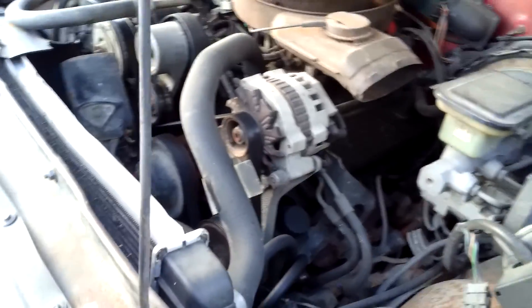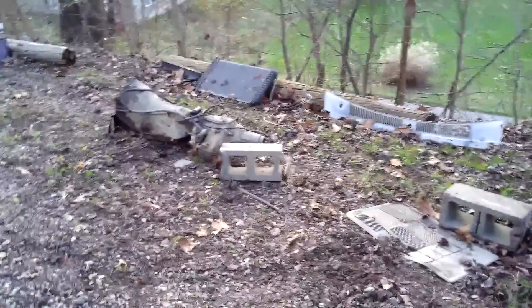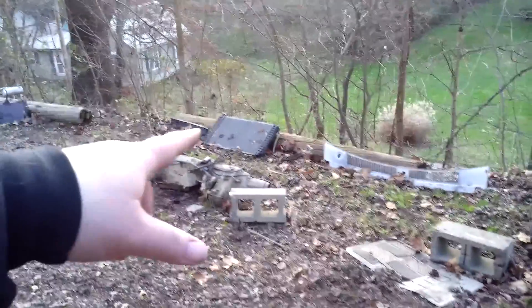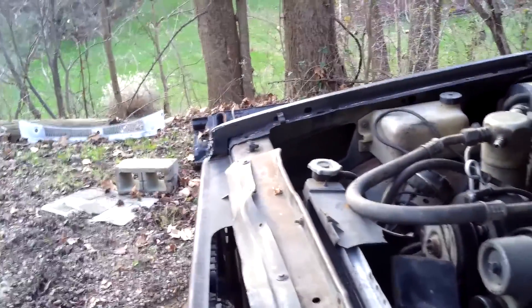The motor wasn't pushed forward — I've already looked at the motor mounts and all that. The plastic piece just broke from being old, and the fan ended up hitting the radiator. So I'll either have to buy another five-speed radiator, or I've got a radiator from a '93 automatic that I think will work. I believe an automatic radiator will work in a five-speed, but a five-speed won't work in an automatic — something to do with where the transmission cooler lines hook up.